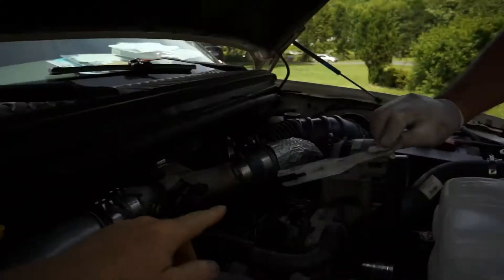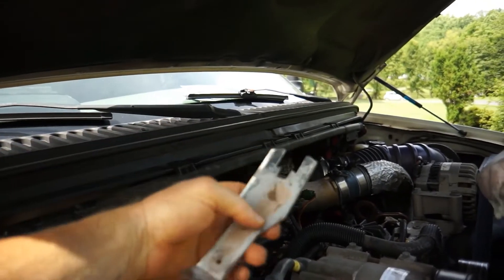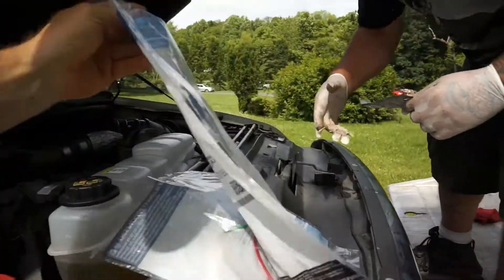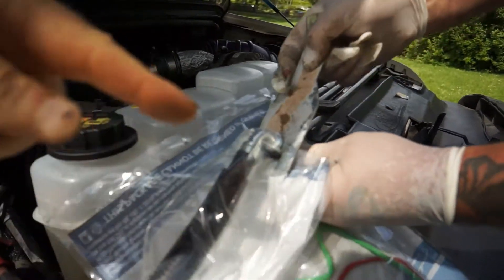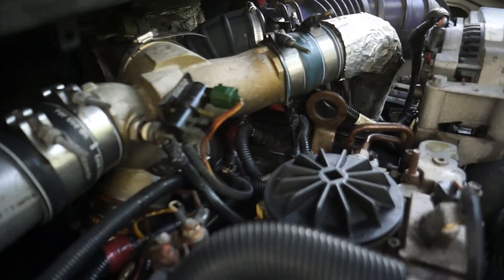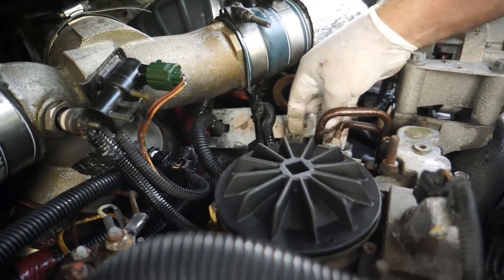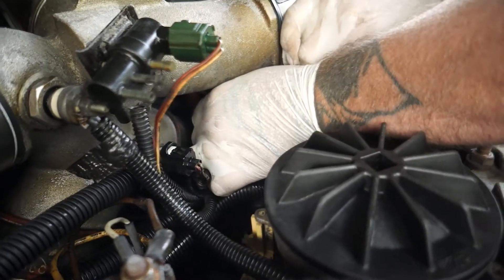The fittings are not a bolt - they're kind of like a push-down quick connect, like on an air gun. We've got this door panel trim tool here - you push this in and it pops those old-style window cranks out. It's about seven-sixteenths wide and it pushes the quick connect down so the line pulls right out. On the oil side we might have to cut our own thin wrench around seven-sixteenths.